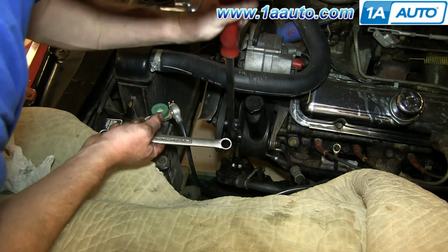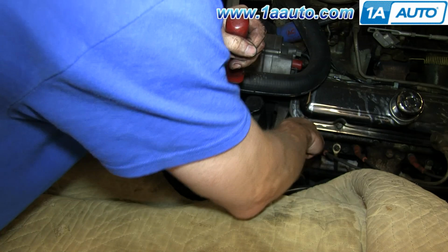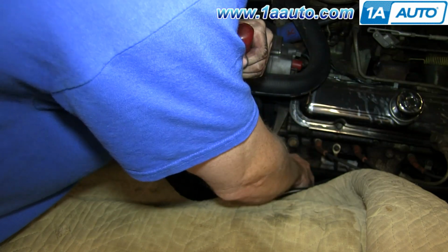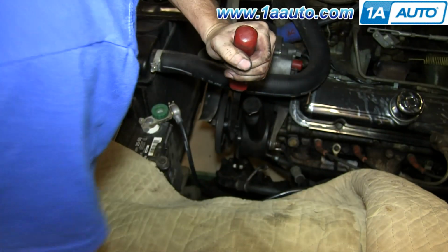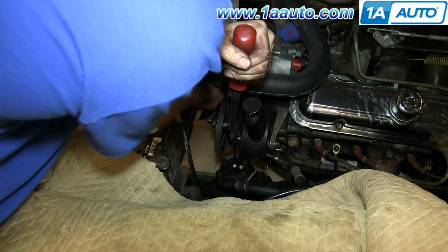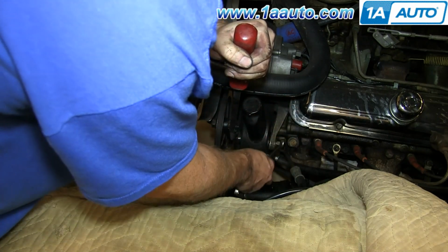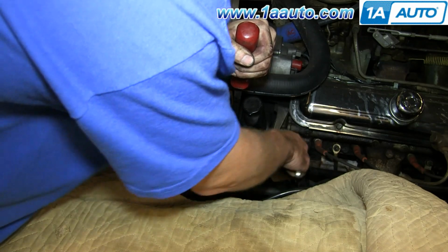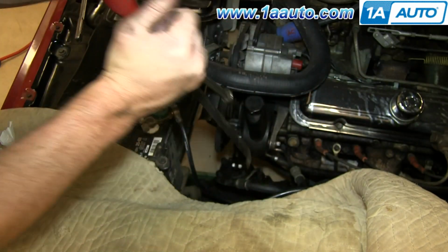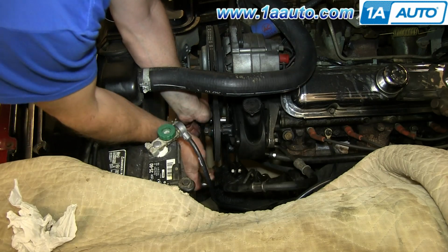Okay, so there's actually a little tooth right here. You can put a pry bar in. I'm going to push on the pry bar, loosen up the nut again a little bit. Put some tension on the pry bar. You don't want to make them too tight because you wear out your water pump quicker. Putting some tension on the pry bar and tighten it. Alright, so now I'm just going to tighten up the other two bolts that hold it.